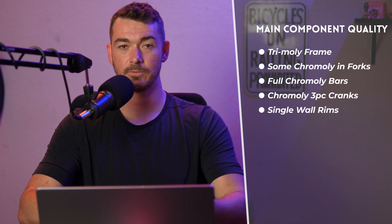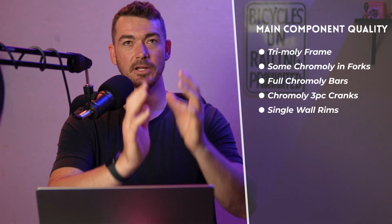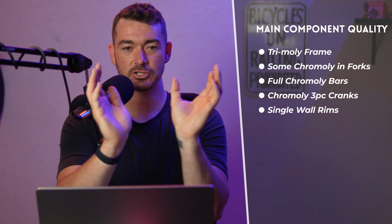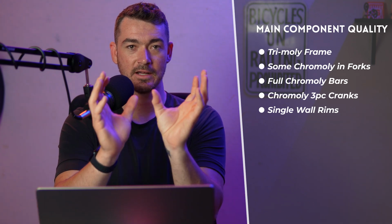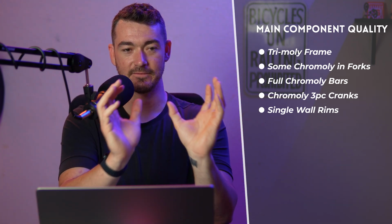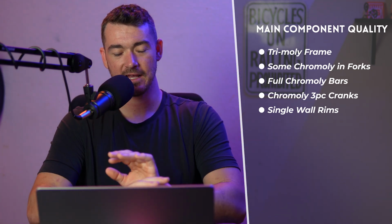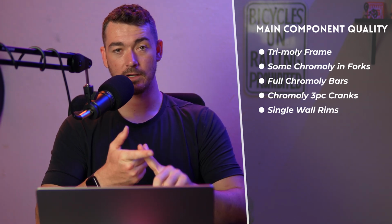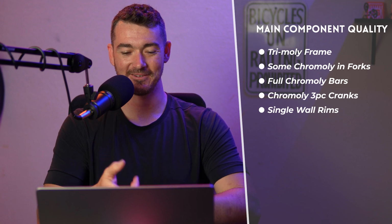When you do jumps, when you do gaps, when you do anything decently big, you're putting pressure on your wheels. And when your wheels come down, they naturally want to flex out like that. And so when your forks are not super strong, they don't rebound back. That flex just kind of keeps flexing and flexing. And eventually your forks are raked out like a Harley Davidson. It's not very fun. So again, keep an eye on the back end of the frame if you're over 150 pounds, and keep an eye on the forks if you're over 150 pounds.